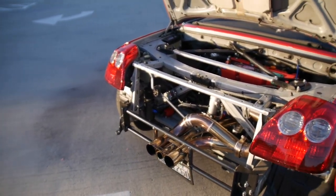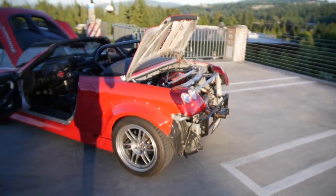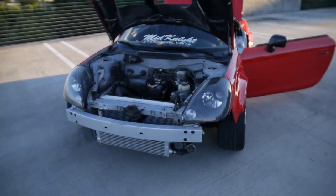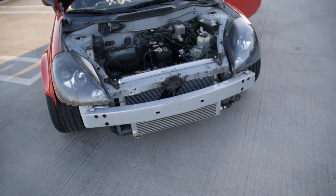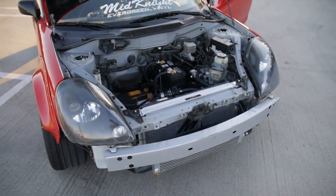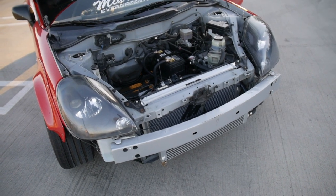Ian Johnson is doing a K-series one, building it from the ground up — kind of like track racing. He's famous for his Monocraft build — crazy build. This old turbo kit used to be off Ian Johnson's car. It actually made 373 wheel, which was estimated on that dyno because it reads low — estimated to be around 459 crank. It made 300 pound-feet of torque all the way from 2200 RPM all the way to 8K RPM, so it had a very steady torque band.